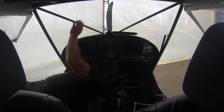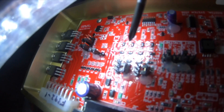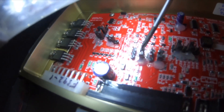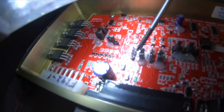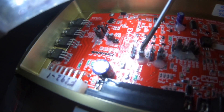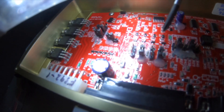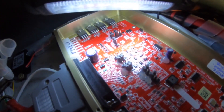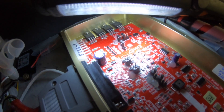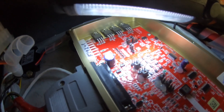I thought this was a good idea at the time. I need to pull this jumper off, which is H6, and I need to solder from H8 to H9, which then sets up the fuel trim. And then I've got to change a couple of wires in this Molex plug here, just so I can make sure they go to the individual cylinders and the four drivers actually drive the injectors, giving the right amount of fuel to the right cylinder.